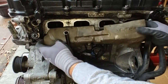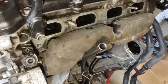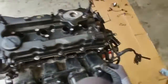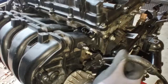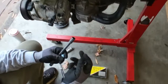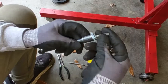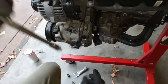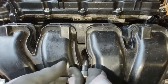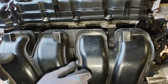Attaching to the fuel injector sound dampener — make sure this clears the dipstick. Put it in on an angle. There are three 12-millimeter bolts and two 12-millimeter nuts. I'll start with the center bolt. These bolts can sort of jump out of the socket, so I'll use a paper towel to hold the bolt in the socket, then run it through the hole until I feel the threads catching.